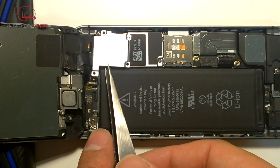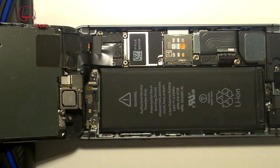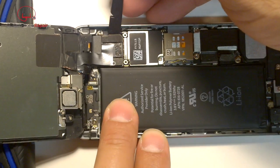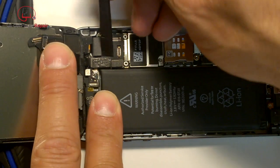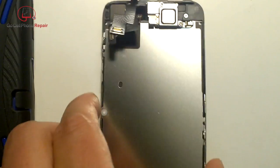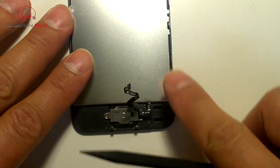Carefully move the plate to the side. Inside you'll have three additional flip pop connectors — one that lifts out, another just beneath it running the other direction, and one final one hidden back here. Disconnect those and you can pull the display completely out from the housing.